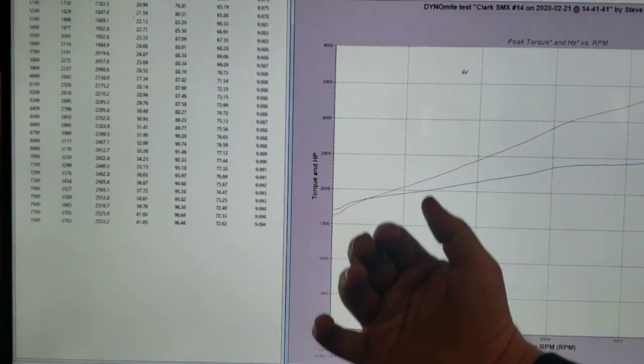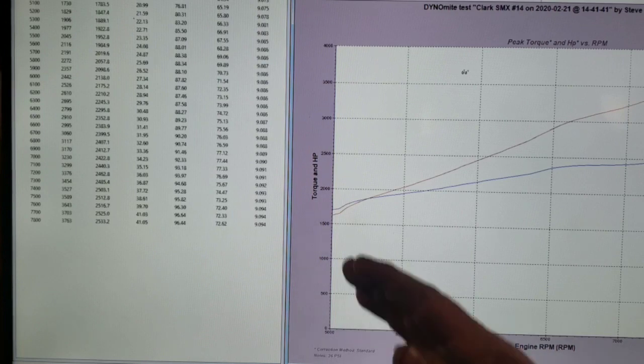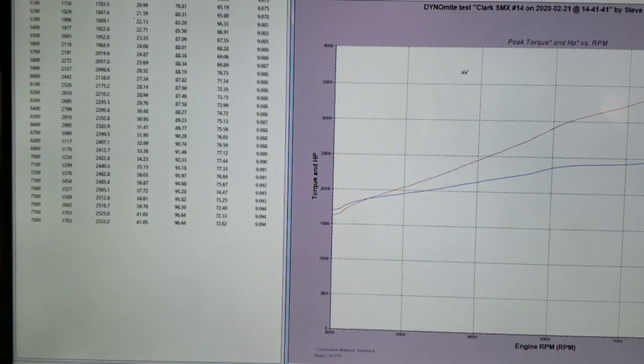You also see the diminishing returns on boost and why this thing is so good at 20 pounds of boost and then 25 pounds of boost — because it is in a really efficient spot on the map for that particular size motor and those particular turbos. Keep that in mind and why you don't see things at 50 pounds of boost make 5,000 horsepower in twins. I've done that when I've done quad turbos, 4 turbos, but they just get in an inefficient spot in the map. On methanol we would run 60, 70 pounds of boost, but I probably wouldn't run this much more than 40 to 50 pounds of boost at the absolute most.